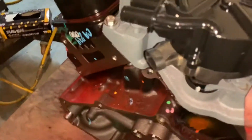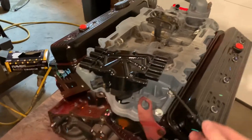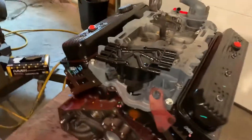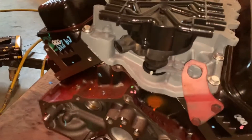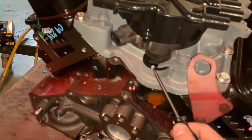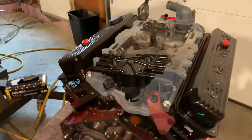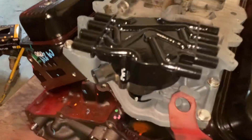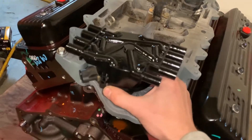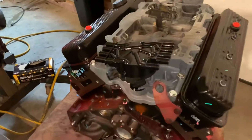First of all, distributor location — here's the lower intake manifold. This will be towards the back of the engine by the firewall. Now, if you're just replacing your distributor, a good thing to do is mark it with a paint marker — mark your intake manifold and the distributor housing itself. That'll make this process a lot easier because you can change the retard timing of the housing itself, and that's something that may have to happen at a shop or with the correct tool to do that.